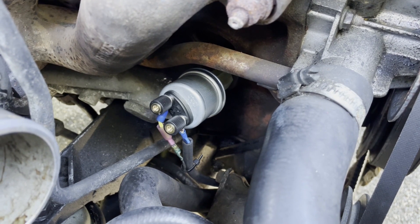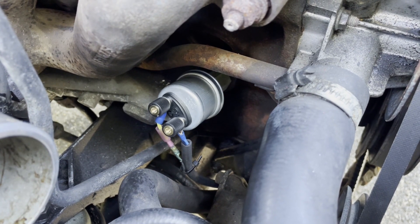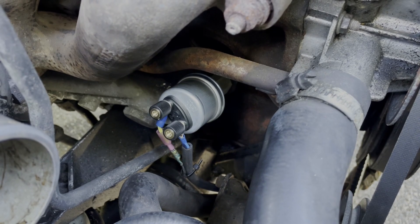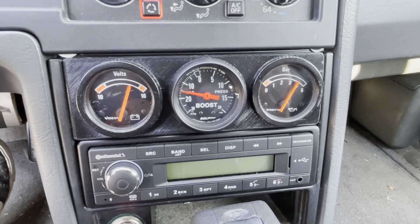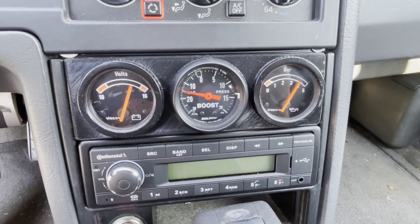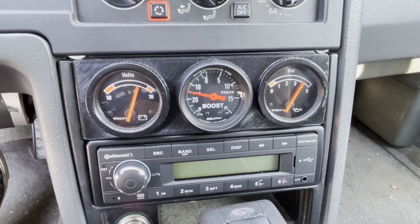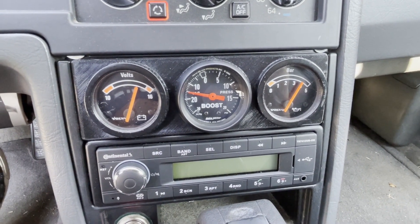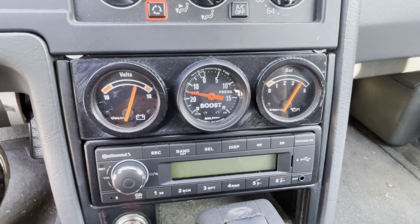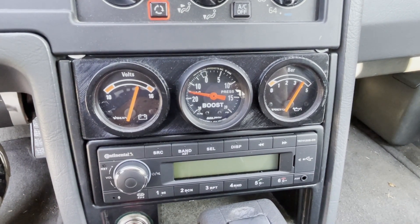There she is — all installed and snugged up nice and good. I'm going to reinstall the turbo and intercooler hoses. The oil pressure gauge is working — I'm really pleased. There are no leaks. You definitely want to check for leaks after getting your engine running; if you don't make a perfect seal you'll see oil running down the side of the block. But once you get it all sorted, you can now see everything that's happening with your engine. Hope you enjoyed this video — see you in the next one, cheers.